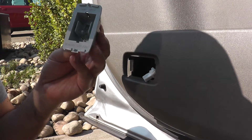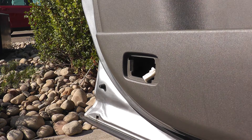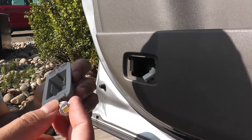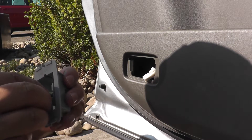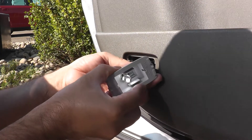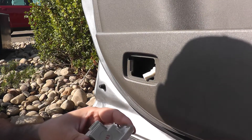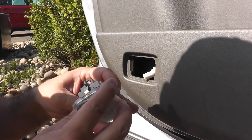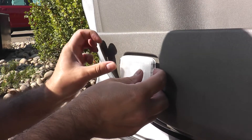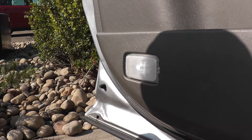Remove the cover and there's the little wedge bulb — just pull it out. Grab the new LED, put it on, and before putting everything back together make sure it works. Plug it in — confirmed working. Twist it back into place, re-plug it, then push the cover straight flat down back into place. That's the driver's door done; same procedure for the passenger side. Next we'll do the middle seat.